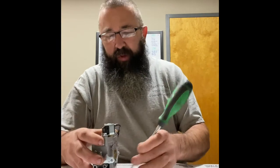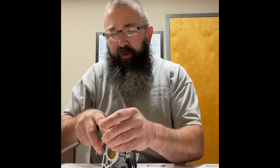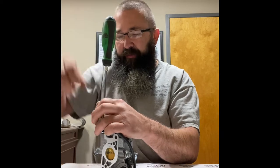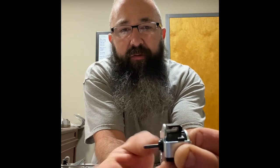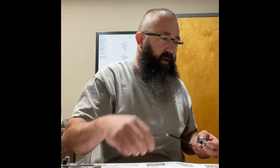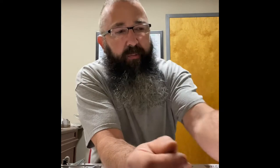Okay, let's go to the first mod that you need to do — because if you don't do this, your tractor is not even going to start, period. These are a newer carburetor, so they have the anti-backfire valve on them, anti-flood valve, whatever you want to call it. It's basically hooked to your ignition. When you turn the key on, this little thing pops away from the main jet. When you shut the key off, that thing pops out and actually blocks your main jet. Obviously, if you're not running power to this, you have no way to control that. So what we're going to do is just take a pair of needle nose and snip it off — at least a quarter of an inch. You can cut the whole thing off. I usually cut this wire off just to make it a little neater looking and bolt it back on. That's going to be one of the mods.